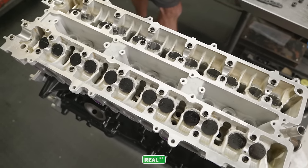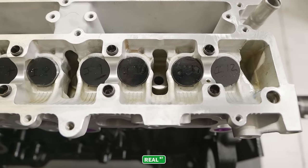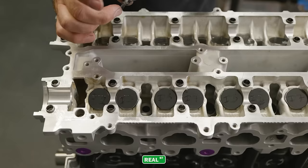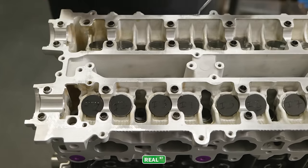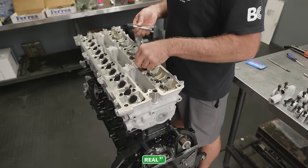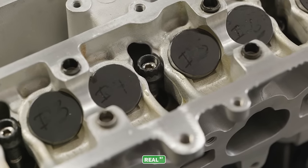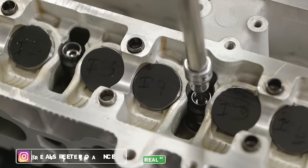For those of you with sharp eyes, you'll notice the DLC — diamond-like coated — buckets. DLC is gaining popularity in the aftermarket and in OEM engine development. It helps keep surfaces intact if lubrication deteriorates or is displaced. Things like buckets, lifters, and wrist pins that are splash-lubricated do really well with the DLC coating. There are now more than one off-the-shelf DLC coated bucket option, so you no longer have to buy buckets and send them out to be coated.